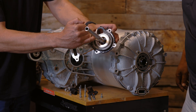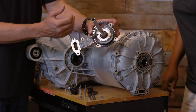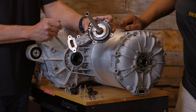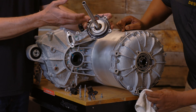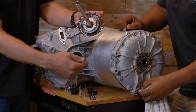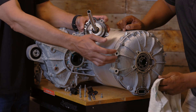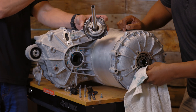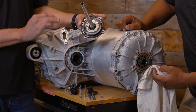There's a rotor that spins anywhere from zero up to 16,000 RPM, and the surface speed eventually wears out the PTFE seal. Once the seal is worn, fluid passes through, blows out the rear bearing inside the motor, and works its way all the way across into the inverter. Once that happens, that's a catastrophic failure.